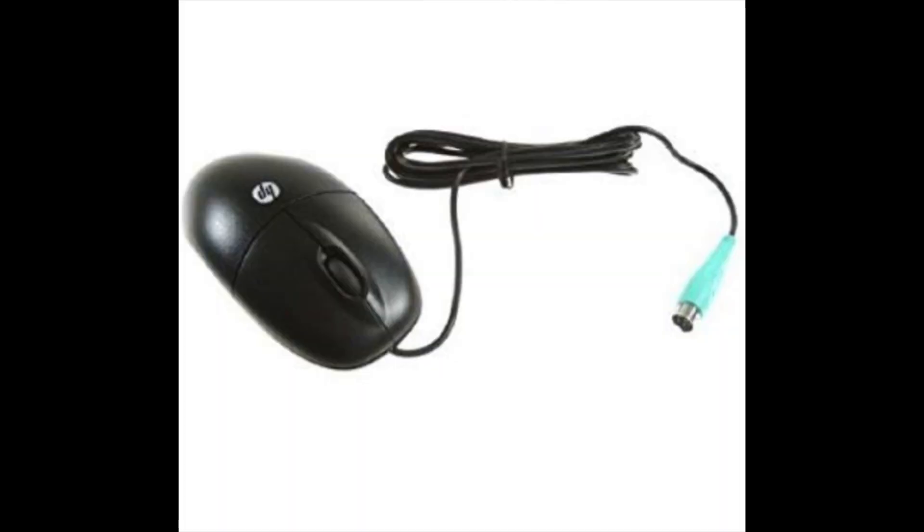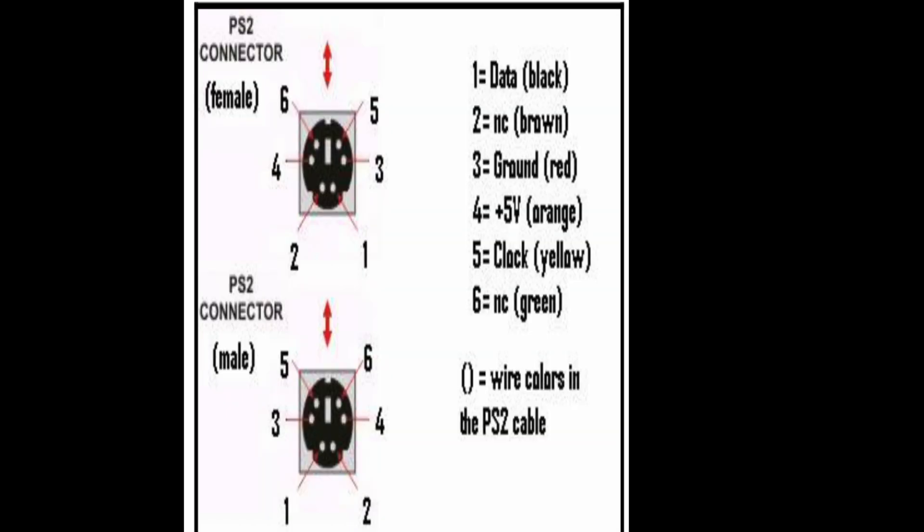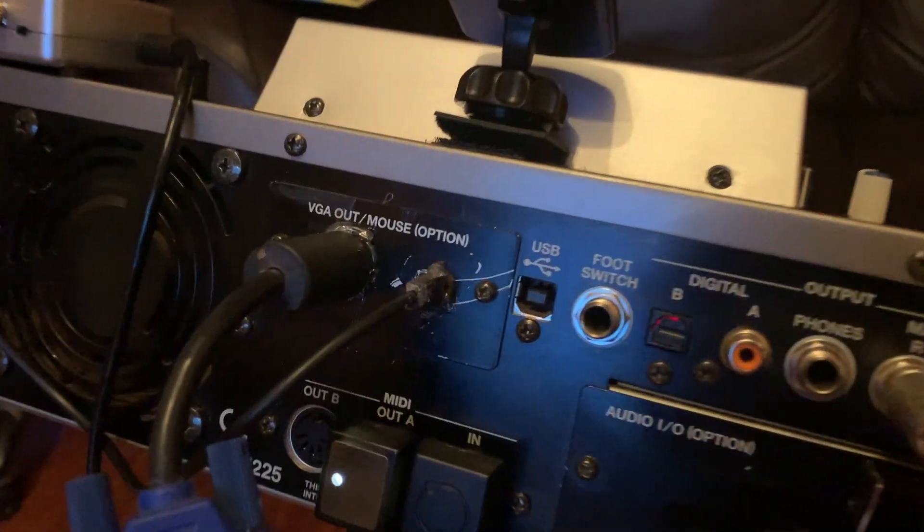The second thing you're going to need is a PS2 mouse. I couldn't find the female adapter to plug into the male on the back of the MV, so what I ended up doing was finding the mouse, splicing it, testing each prong from the PS2 connector to the wires, and writing that down on paper. After I figured out what colors represented what, I just connected it straight to the MV. Granted, I could never unplug the mouse, but it worked fine.